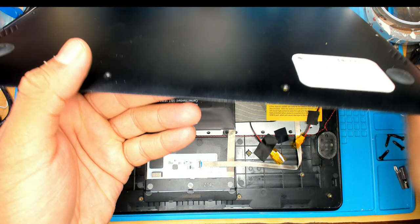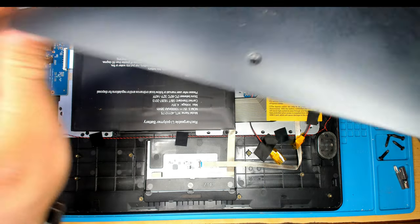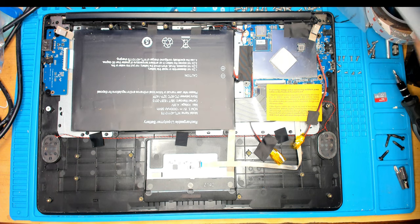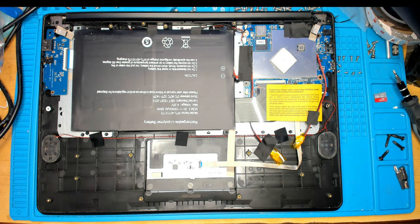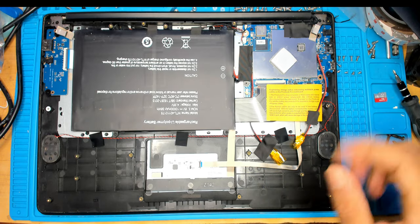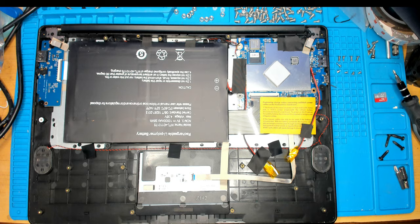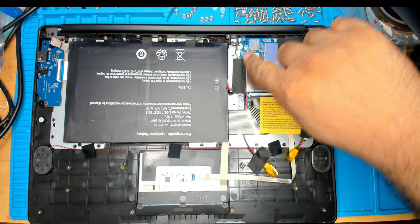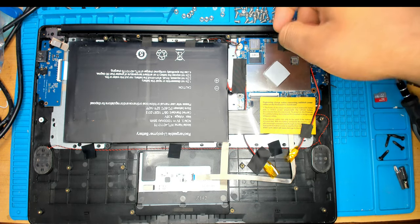I mean, one thing I wish these guys would have improved upon was the speakers. Speakers on this laptop are absolute crap. Right, so that's the main board. Lowering the brightness so everyone can see, because everything's really reflective here. That's the eMMC. So this is the switch that seems to be disabling eMMC for us. I think I should just pop this eMMC out